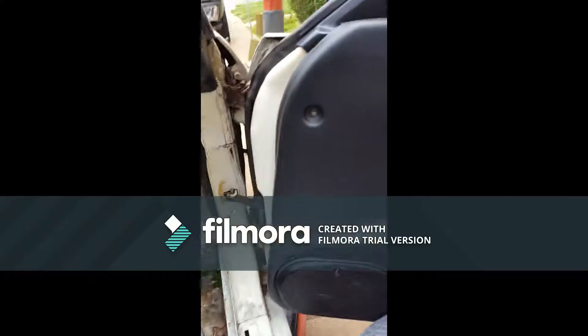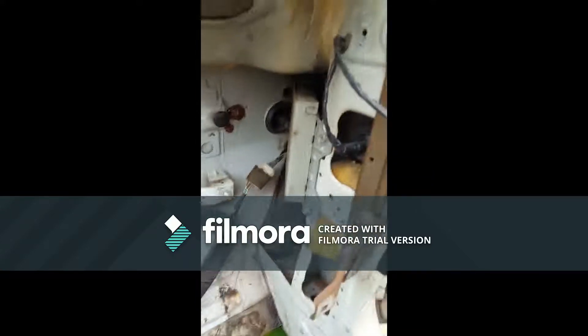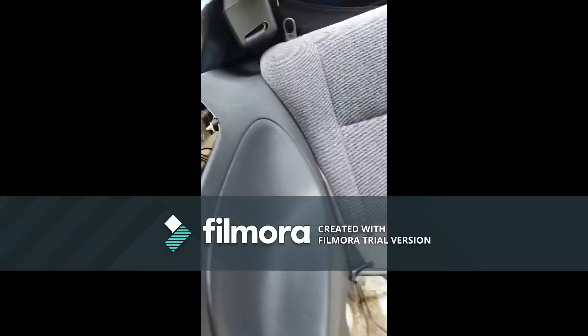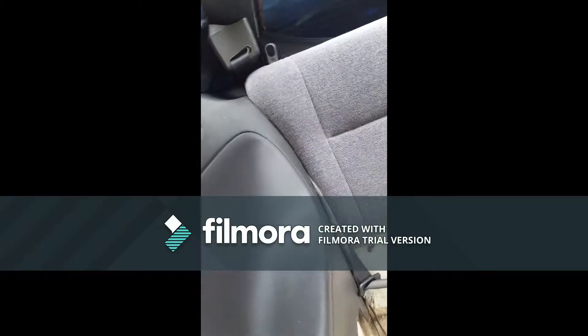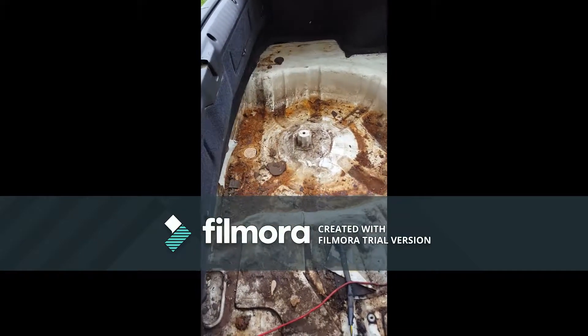Now that's gone — clip that mess of wiring, get that out on that side. Remove that, whatever that is, so I can get the wiring harness to go out through the front of the car. I wanted to let all 240 owners know: before taking this off, make sure you take your clips out and take your time doing it, because these clips are very fragile. I haven't broken any yet and I'm trying to keep it that way. I've seen other YouTubers break them because it's old and fragile, so take your time and do it right.